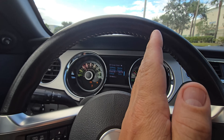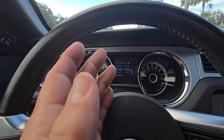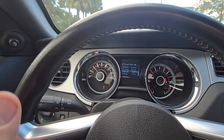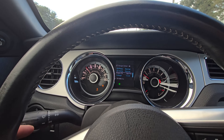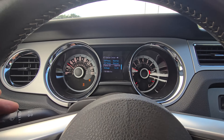So it'll go to fourth, and in fourth it should lock at around 60 miles an hour because at wide open throttle I'm not going 60 miles an hour in fourth gear - the top of third gear is already way up there. Let me find somewhere to park, make my adjustments, and we'll test it out.